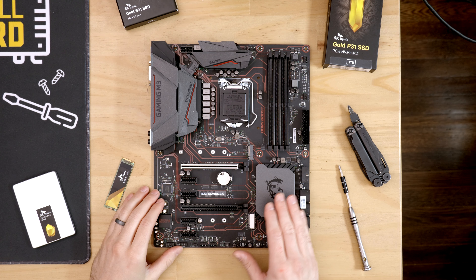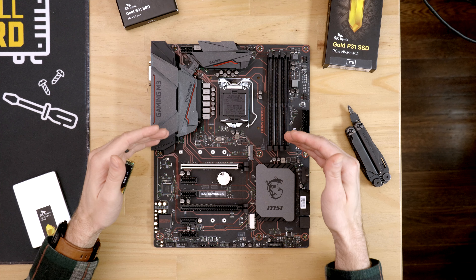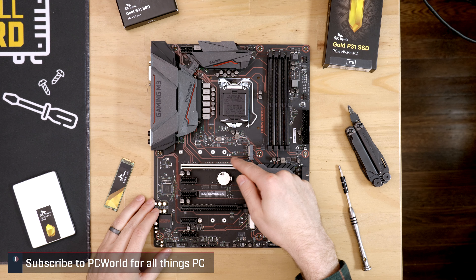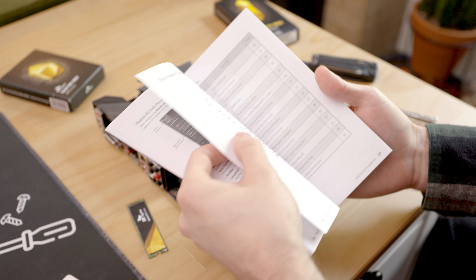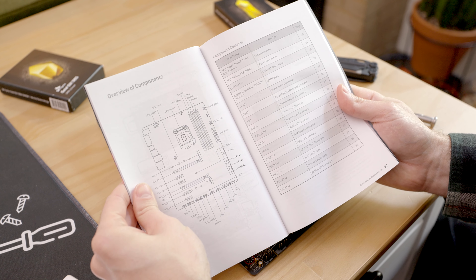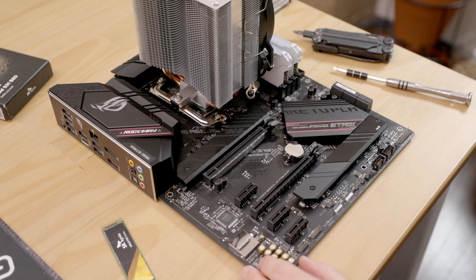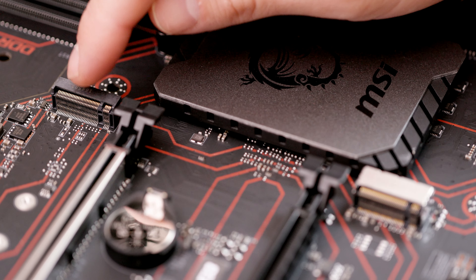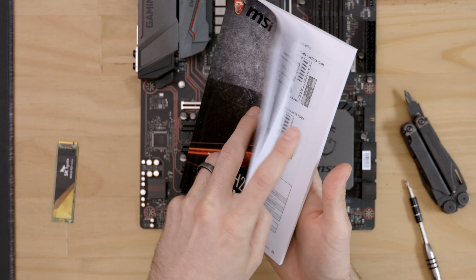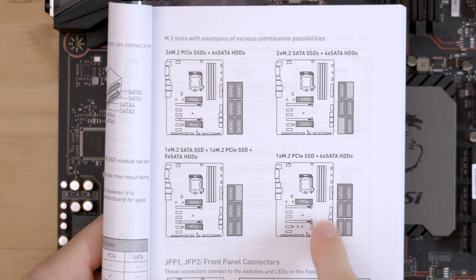With that in mind, we are looking for a slot about 1 inch wide that protrudes from the motherboard about a quarter of an inch. It is not always labeled. Every motherboard is different, but the most common locations are below the CPU and around the PCIe slots in the lower half of the board. If you're struggling to find the placement, consult the part of the manual that shows the motherboard layout. Some motherboards have a pre-installed shield that serves as visual flare and a heat spreader — this will need to be removed before accessing the M.2 slot. If your motherboard supports two M.2 SSDs, consult your manual to see which slot is recommended for your boot drive, as each slot might offer different performance levels or might disable a PCIe slot if used. Basically, read the manual first.